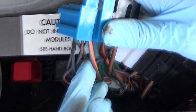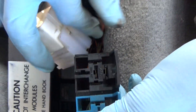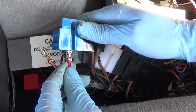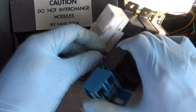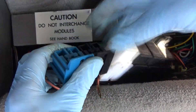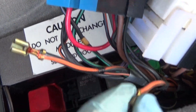To do that, we need to remove the orange-black terminal from the socket, like that, and then the brown-orange socket from the fan relay. You can then bridge the two relay sockets together with this wire. And now these two sockets are bridged. The circuit breaker is now unconnected. We're going to put some heat shrink tubing on those connectors just so they don't touch anything.